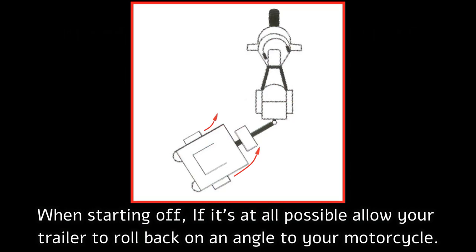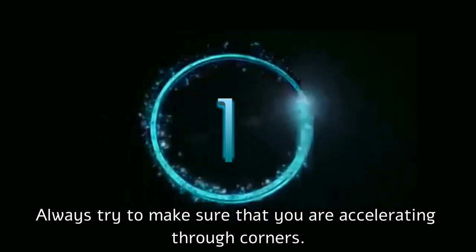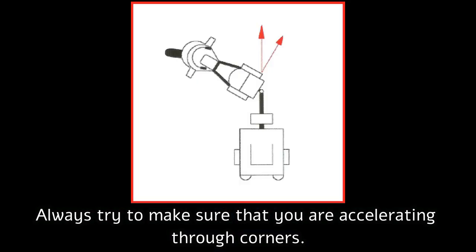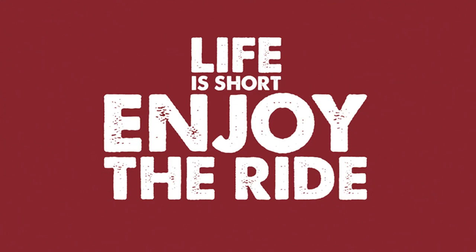You can eliminate annoying chain rattle — you can even make your own solution using an old bike tube. The strain on your motorcycle's clutch will be greatly reduced as all your motorcycle is doing is straightening the rig. If you are slowing down, your trailer will always be wanting to go straight ahead. If you must brake during a corner, you should lift your motorcycle up and try to straighten your rig out, otherwise your trailer will try to push your rear wheel out from under you.